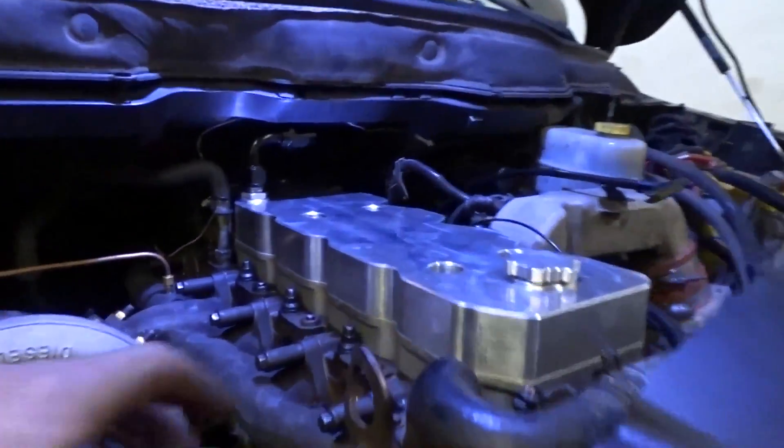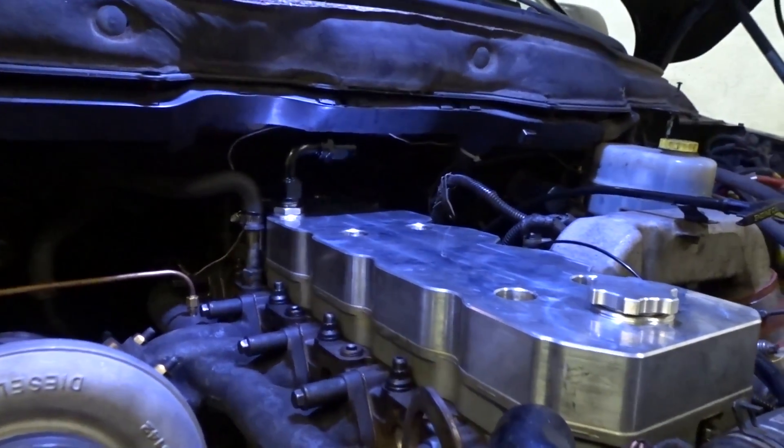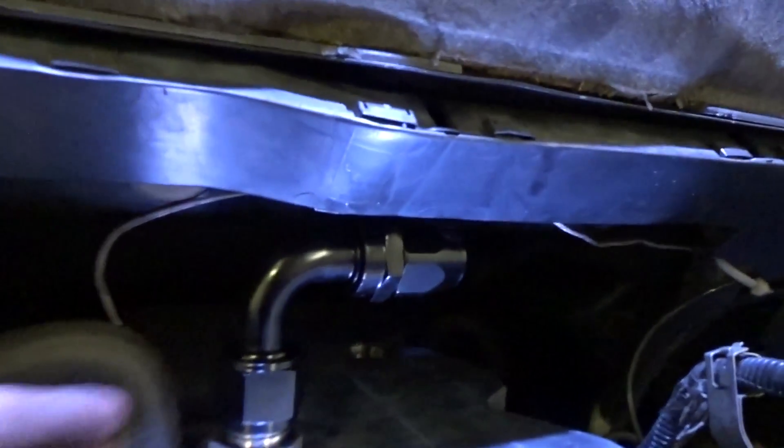Alright, hopefully that fits. Just drilled a little hole — it doesn't have to be deep, I was only sticking up maybe an eighth too far, just enough to get those bolt heads out of the way. Put it back in there and you can see now it doesn't rock around at all, so it's good to go. That problem's solved. On to the next thing — this 12AN line here. Look at it, it's pretty tight.